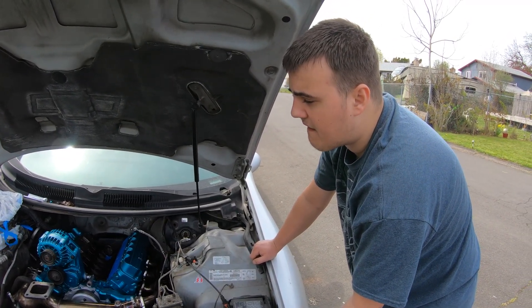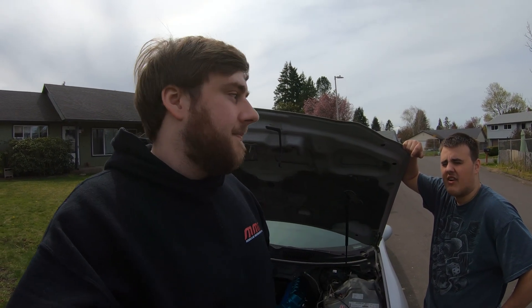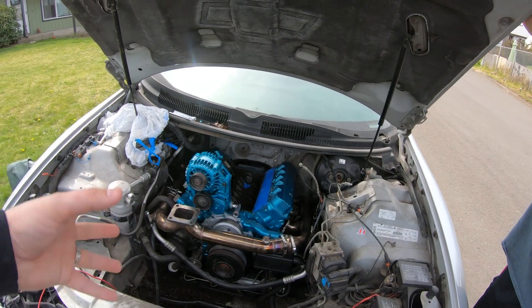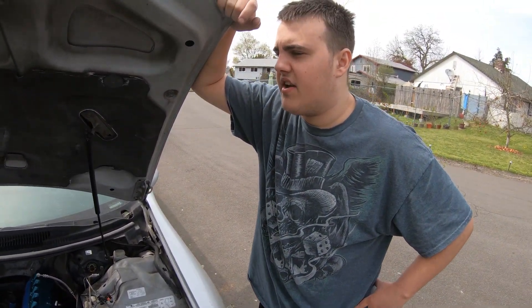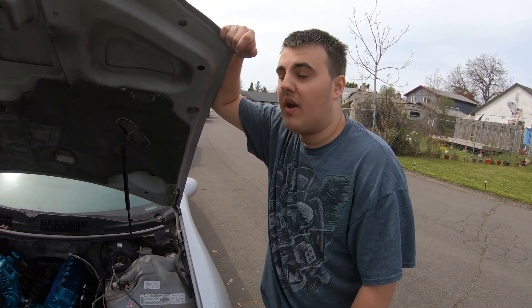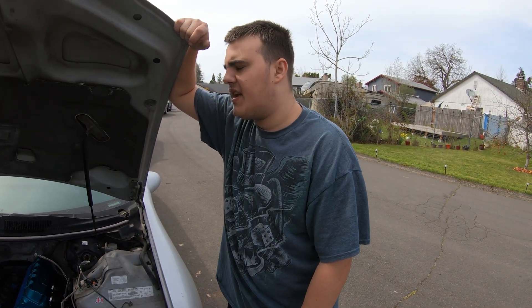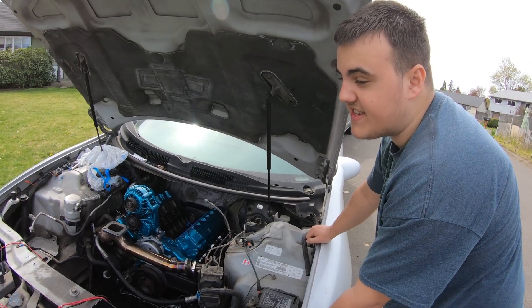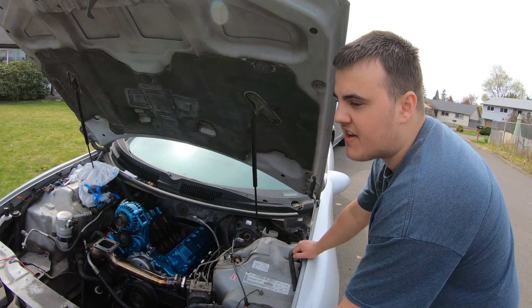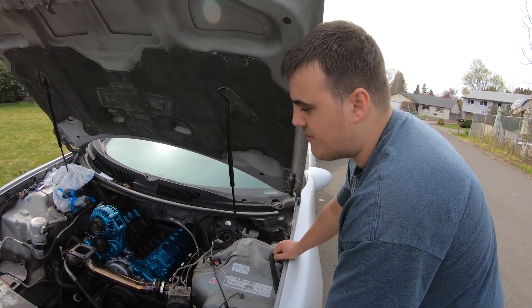There'll be a lot more progress soon. We also decided on the turbo — comment down below and let us know your suggestions. We think we're going to go with a GTX 3582R from PFI Speed. It's a pretty decently sized turbo with a lot of potential for this size of motor. Realistically, with that turned all the way up, we could make 600 horsepower or more. I was actually going to get a smaller turbo so it spools faster, but the one I was looking at by CX Racing was only capable of making 500 horsepower. They said the GT35 actually spools slower than the GTX 3582R. So we'd rather get a turbo capable of making more and then turn it down than not have enough headroom in the future.